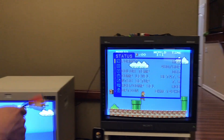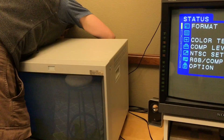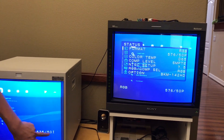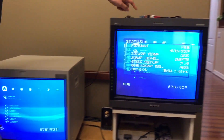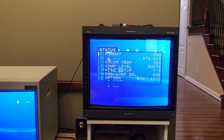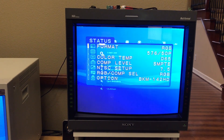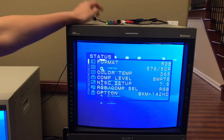So I'm going to take my Raspberry Pi, plug the composite video cable in. Going over to this PVM, you can see 576, 50i. And then it's looping the composite video to the 2X, which is then outputting through RGB via the VGA to HDMI. You can see 576 50p, so this device is effectively line-doubling the PAL composite signal to 576p, and it also works in pass-through mode.